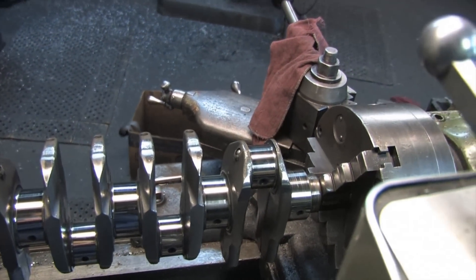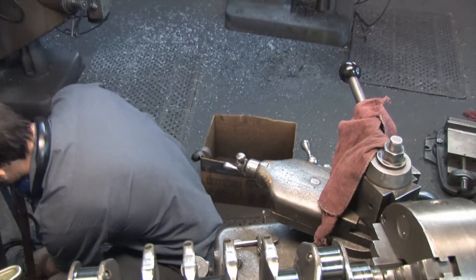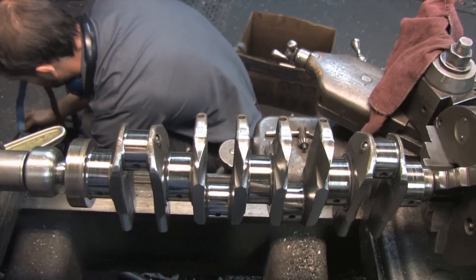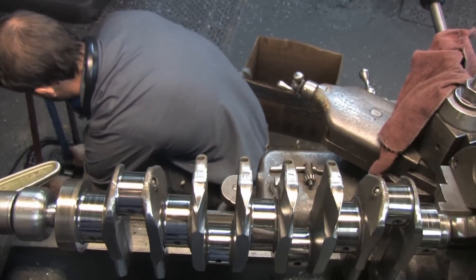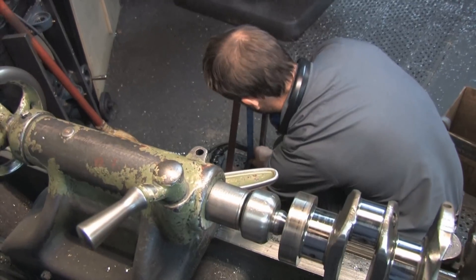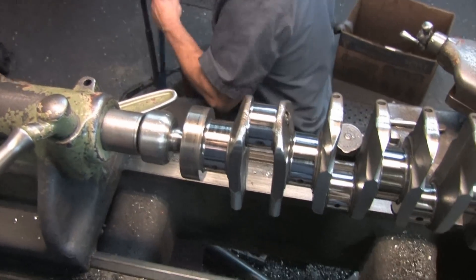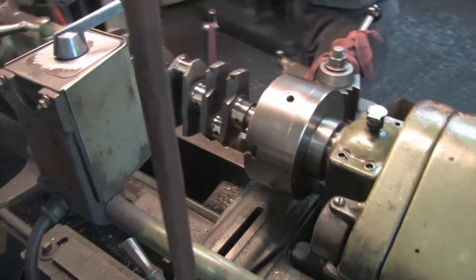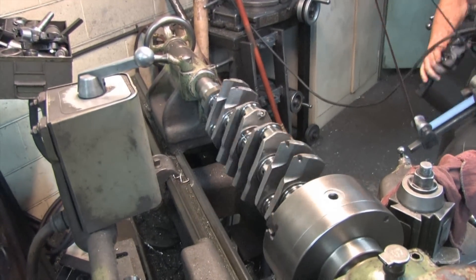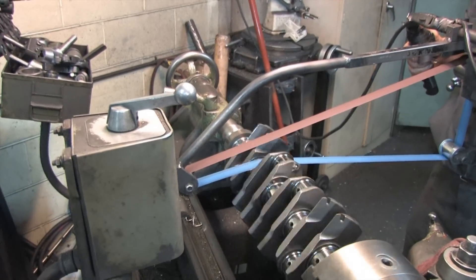You're going to knock it down? Yeah. It still may not come out. I understand. It's always kind of touch and go when it comes to those little scratches — they look and feel like nothing. You're going to take a half a thousandth off of it and it's not affected at all. What grit is that? 400. What do you normally polish with? 400. Your roughing polish belt is a 320 — that would be your first step after grinding. And then you narrow it down. You can get to like a cork belt, put a super shine on it, and then they have tape machines. None of which we have. Those specifications are probably something you'll need to provide if you ever have something like this done.